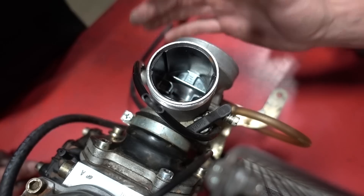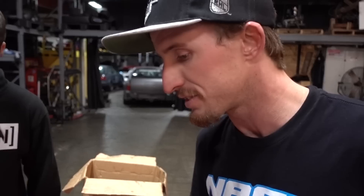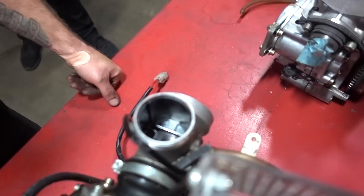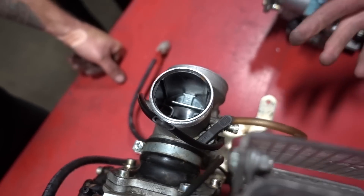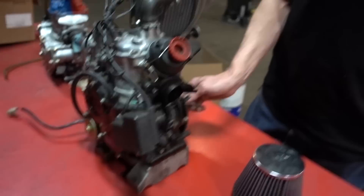It's a super easy thing to change. You pull the drum off, it's three little bolts, boom — slap a new one on. This is the carburetor that goes with this engine because it was set up. The last time we used it was at a race, so it's a race engine — the thing should rip. The carburetion is definitely important on these because these engines are kind of over-carbureted. If you put a smaller carburetor on it, it would run just as good, if not be a little more responsive. This thing should be good — let's bolt it on and see how it does.